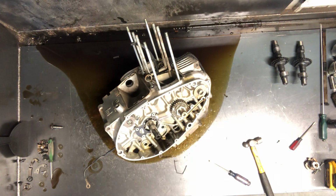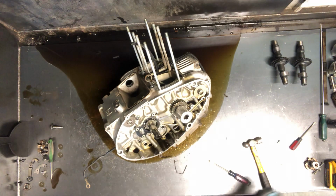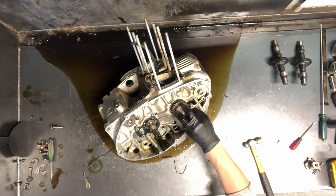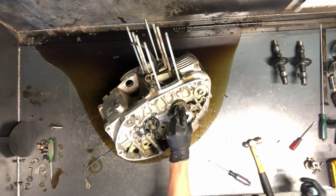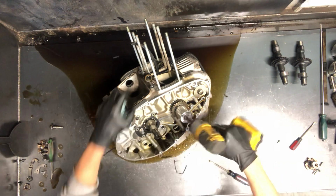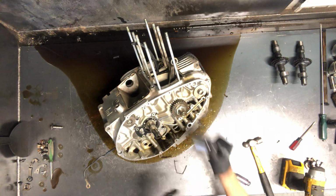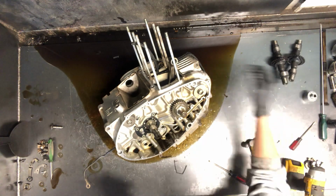We've got this larger nut here. To split that case, this won't actually have to come off, but we'll just go ahead and do it now if we can get on there. We should be really using a deep socket, 1.25" deep socket, but I think there'll be enough that we can grab onto there. Cancel that. There's not. Grab a deep socket, then do that one.